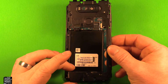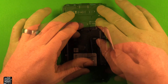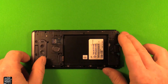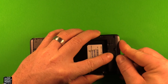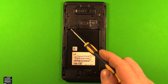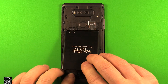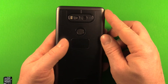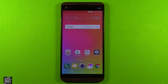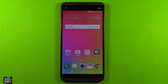Next to reinstall this back part, set it down where it lines up and snap it in. Then grab your top piece and slide it on, then grab your bottom piece and slide it on as well. Go ahead and put all 16 screws back in all the way around. Next grab your battery and set it down in here, then grab the back cover — get this side locked in first and press down on this side. Then turn your phone back on, make sure everything's working, and you're all set. Thanks for watching.